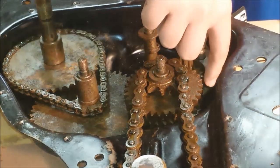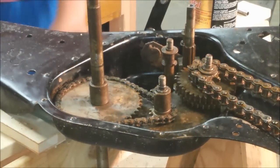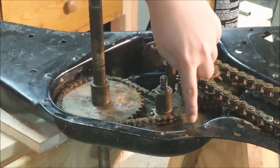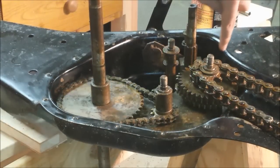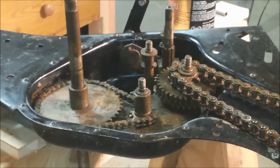the bottom gear only. That's the one we had to go back to because we had the other one down in there. So you put the bottom gear in, then you put the big plate. It's another big gear that goes to the small chain. And then you can put the other two and the big chain on, and that way you'll fit them all together. Otherwise, you won't be able to get that one in there because it's a large gear underneath the rest. And that's it. So, all together.